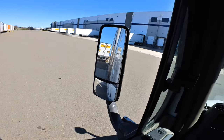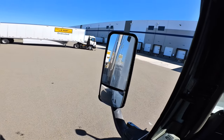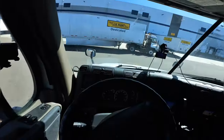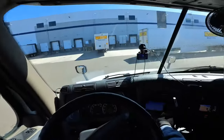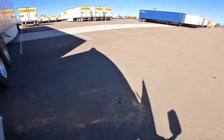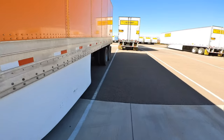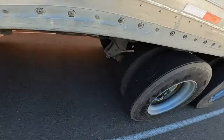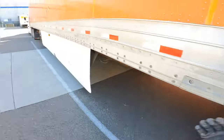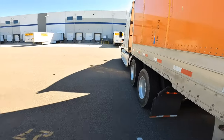So you're going to go back inside your truck. I always like to make sure everything is squared away too. If your trailer brake's on, put it in reverse and you hear a release sound like a plop — that's it. Now you want to go ahead and put it in low or first. Do it slowly. When you hear a hit — there we go. You're going to come back out, set your parking brake — just in case you don't want it moving. Come here and then just lift this up. Your pins are somewhat out now. Once you move your trailer and truck you'll hear a click — they're in place and you're good to go.